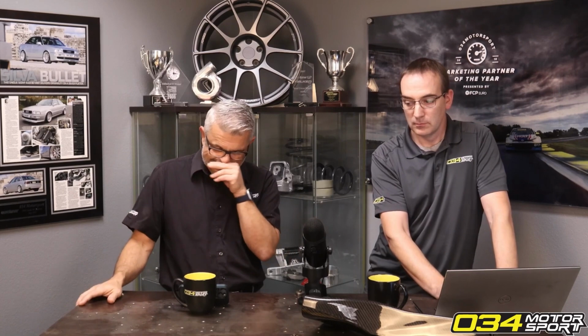So the chassis brace is not part of the suspension. It's part of the frame or chassis. And so any effect that could be had by stiffening the frame or chassis, a strut brace or a chassis brace like that would affect, which is mostly just helping keep the frame more rigid. So you want changes in suspension alignment and movement to come from the movement of the suspension itself, not the flexing of your car or suspension components.